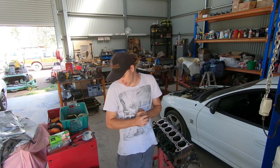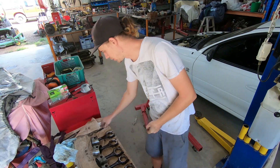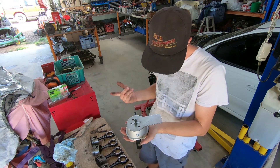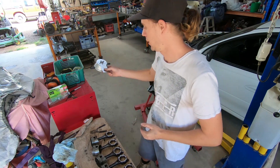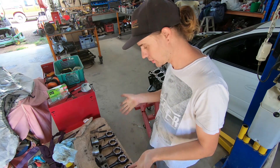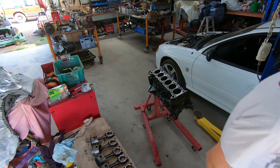So let's get into gapping these rings. As far as tools go, we're going to need ring pliers - very handy when doing rings. This here is called a ring gap file or ring gap tool - pretty self-explanatory, it's for filing down your rings to get the correct ring gap. It's not strictly necessary but very handy to have. And you need a good set of feeler gauges because that's how you measure your ring gap.